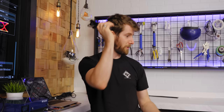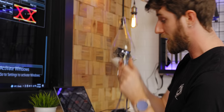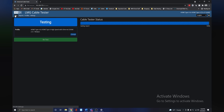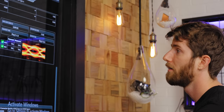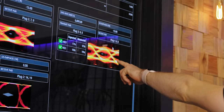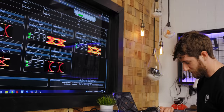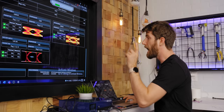This one is poo-poo. Here's one of our longer HDMI cables—supposedly a 4K UHD cable, so HDMI 2.0. Oh, wow—that's a pass! You can see it's a lot messier, but that's really close. That's what happens when you have a super thin cable that's longer—you got a worse conductor, a worse signal integrity. Either way, it's a keeper. I want to see how close it can get for HDMI 2.1 spec, though.